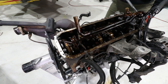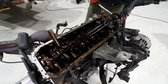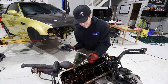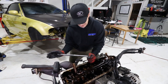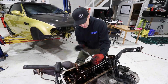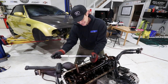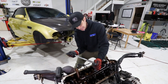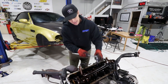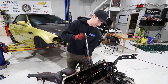Here they come around. The Germans like their high torque specs — they certainly do. And the bolts are 12-point, so make sure you have a 12mm 12-point socket for that.